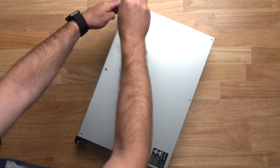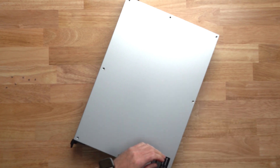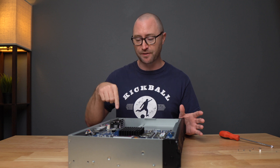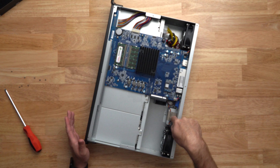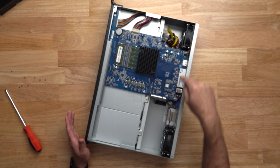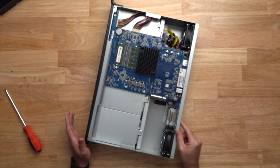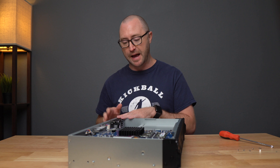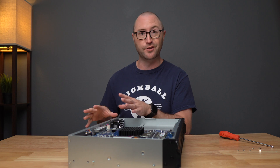With the NAS turned off, we can remove the 8 screws on top and open up the case to see what we are working with inside. With the top off, you can see both of the fans in the back. One of the fans runs the cable under a piece of tape and then up and around. This fan looks like it just comes up from the bottom and plugs in right here onto the motherboard. So these should just be simple swaps — a couple of screws on the back, pop these out, un-route the cable, route the new cable in, and hopefully we're all good.